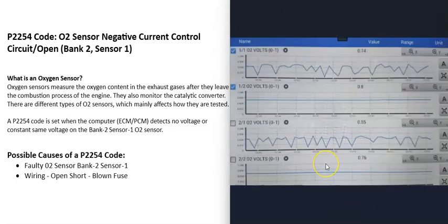If you have a good OBD2 scan tool with live data or data stream, you can use it to test these sensors. For example, on a scan tool showing all O2 sensors — bank 1 sensor 1, sensor 2, bank 2 sensor 1, and bank 2 sensor 2 — sensor 1 should show an up-and-down voltage pattern as it reads oxygen content, while sensor 2 should be flat. If sensor 1 is flat or the voltage is very high or very low, there's a problem with that sensor.